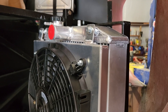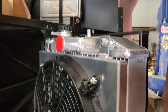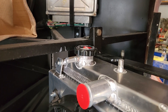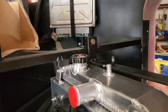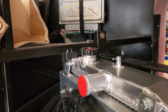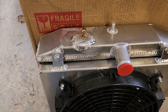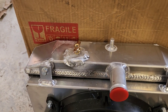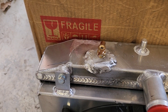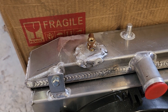Side two. I got the frame in, which is good — but I really should have tried the radiator first, because now the cap hits the bar. I want to have a remote fill on these anyway, so I'm going to have to cut the damn cap off and plug it. Removed the filler cap and put in a bleeder valve. Haven't used my aluminum spool gun in a long time — welds are ugly as heck, but it should hold.